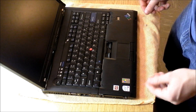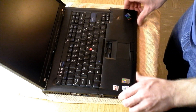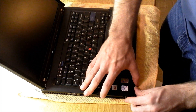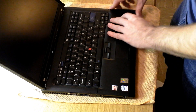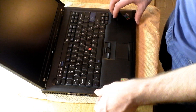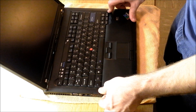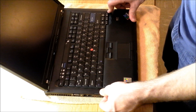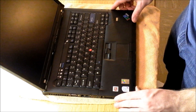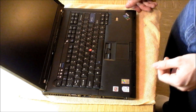When you're putting this piece of plastic back on, you want to make sure it clasps up underneath it first before you push it down. Just make sure it's all down. There are two little lips on the sides here — those are going to need to go down as well, so make sure they get seated properly. Then flip it over, replace the screws, and you've upgraded your RAM.